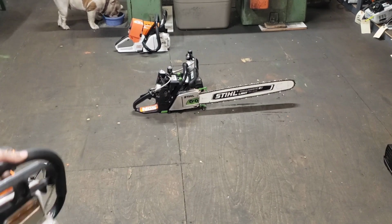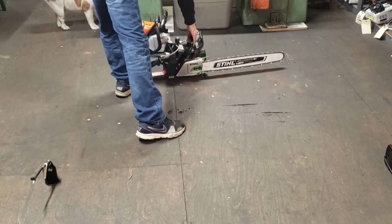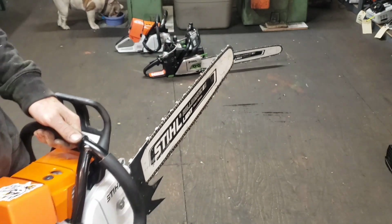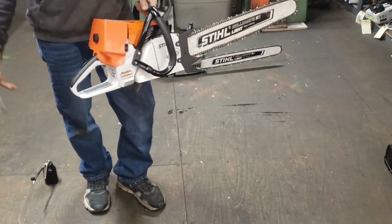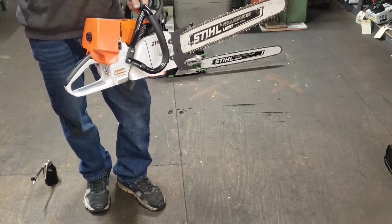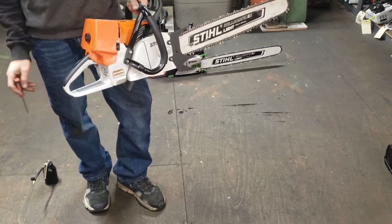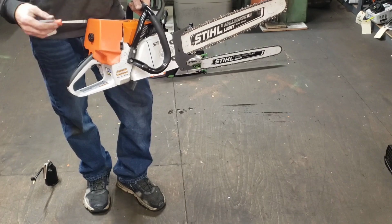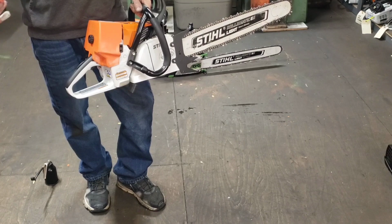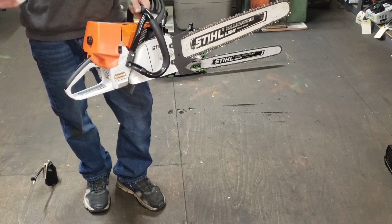Okay, we've got the nitrous saw sitting down there. That thing sounds ridiculous. Now, the way I'm going to do this, for the first heat cycle, I'm just going to start it and let it idle, and I'll just show you how I adjust the initial. If I hear anything that needs to be adjusted right off the bat, I'm just going to adjust it, and then I'll kill the video, because you got to let it idle for a good 2 minutes, maybe even 3 minutes. Let the piston swell up, and then I'll do my adjustments. So I'll cut video, and then I'll show you how I adjust after, and then we'll talk about, on a normal saw, lean drop off, how to set your idle, how to set your low and high. We'll talk about all that.